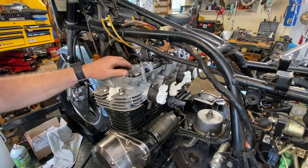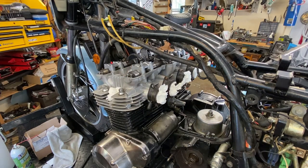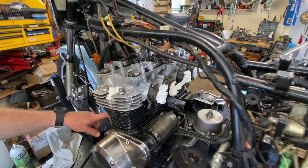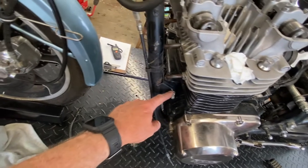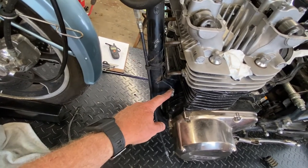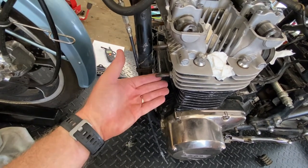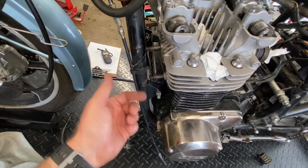We'll go ahead and just take the top end off, take the cams out, and do the whole thing, and that way it'll be a lot easier to get out. Because when you see my rig, you'll understand that we have to capture these two over here in the front. We've got to capture these two upper, well, actually the only ones in the front, engine mount locations for the actual lift points. Normally what I do is jack the motor up and then capture those, and do the same with the rear, and then I can just pull it out.